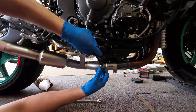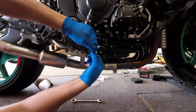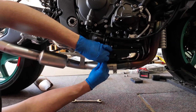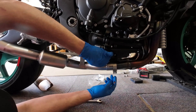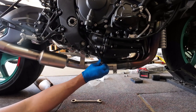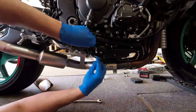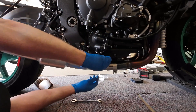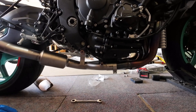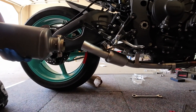Because we're going to turn it clockwise in, I don't want it bunching up too much. So what we're going to do is put a whole bunch of twists in the wire going the other direction, so that as I screw this in it untwists it. Oh, I tore my glove. See how it's now untwisting? Hopefully I put just enough twists into it that it's going to be perfect. Look at that — I am good. So we'll put that in, and then I think I need a 17 mil on the other side to tighten that up. While I'm on this side, let's go ahead and put on the muffler.